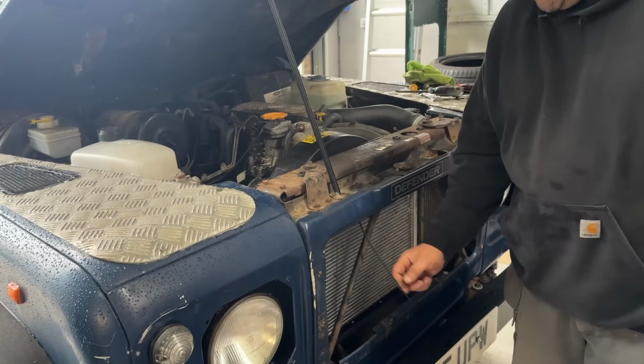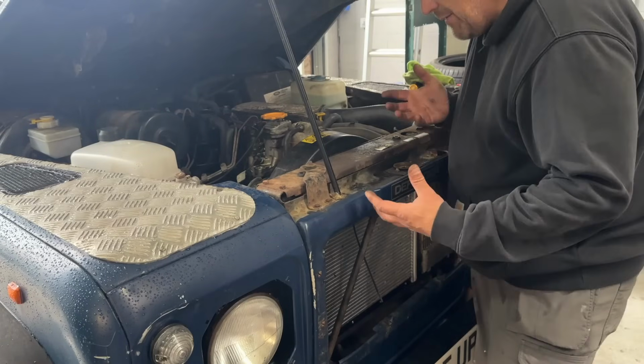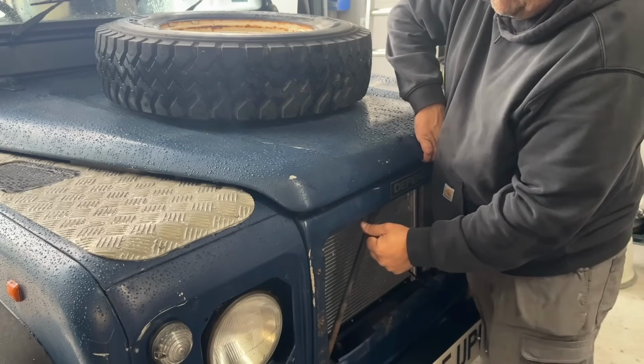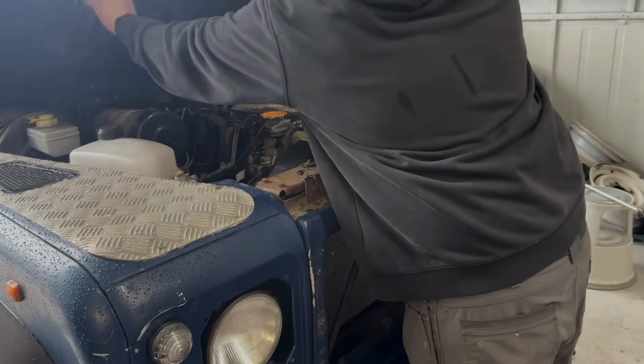an additional pull cable. So we can tuck that behind our grill, and at least then if we need to open it, one person, just me, because of the weight, rather than taking the wheel off, I should just be able to pull that down and feed it through my grill, pull that down and then lift the bonnet. And we've got a secondary release.